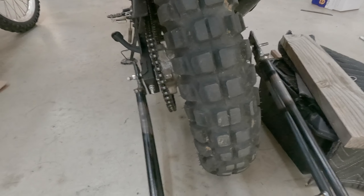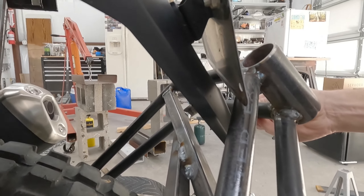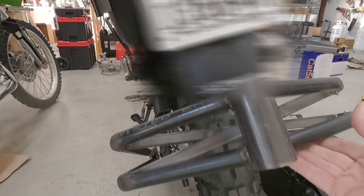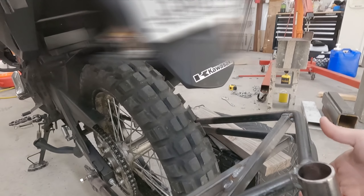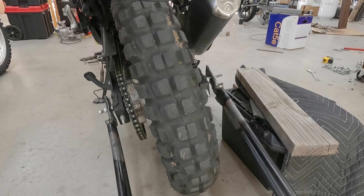So that's how I fixed it — just a couple of propane torches, I didn't need an oxyacetylene torch. There we go, I've got the x-brace on there and it still clears the fender for the most part. I mean, eventually it's going to hit something at a big enough angle — I can't stop that without making it super long, and I don't want it super long. But while I have a trailer on, I shouldn't be taking angles that big anyway. If I do, the next step would just be to get a fender eliminator. So now I'm going to clean this thing up, get it painted, and get it ready for some actual road tests.